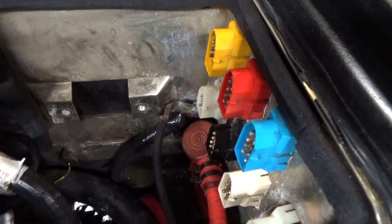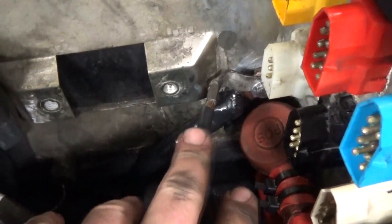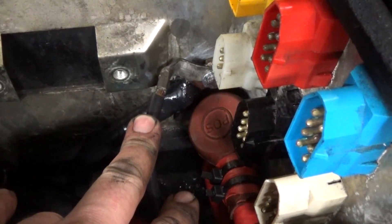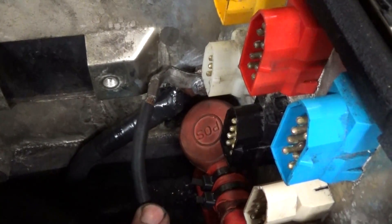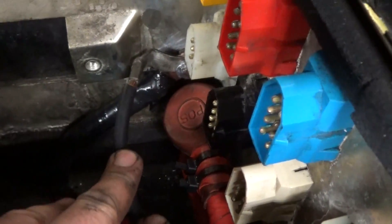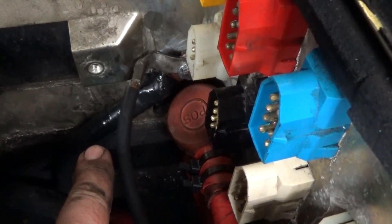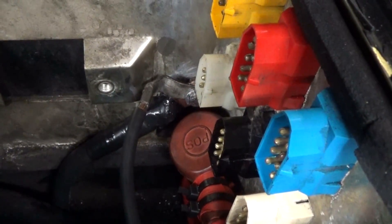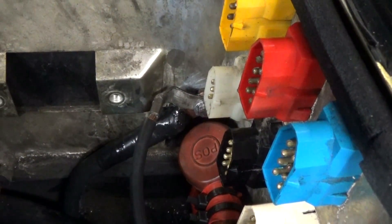That takes care of the bulkhead ground fortification, or as I like to call it the John Hervey style grounding. I left the original ground in place — that's something I firmly believe in doing. Whenever I reground something I'll still keep the old ground in place just to be on the safe side. This stock ground leaves a lot to be desired, but the new zero gauge welding cable ground is going to be a lot better overall. I think it's going to make a big improvement. Anyway, that's the video — thanks for watching.